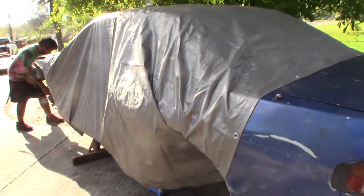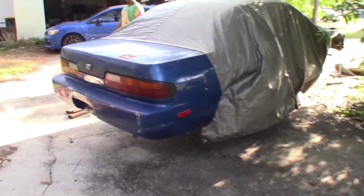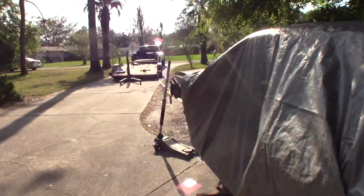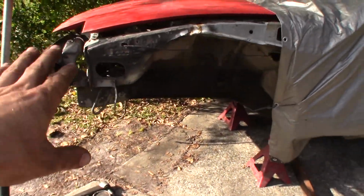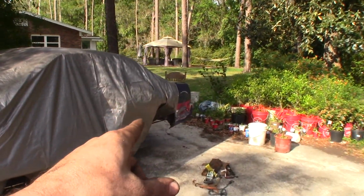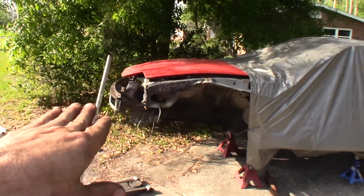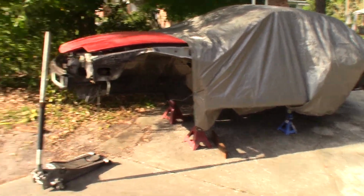Anyways, as you guys saw, we got the car unloaded. It's on jack stands. Really wasn't as bad as I thought it was going to be trying to get it off the trailer. She came right off with a little bit of convincing. Winston had the floor jack up front with the large 2x4 across the front, and he just held it. Nate was in the back with the cherry picker. We jacked it up there as you guys saw, and I just pulled the trailer right on out. We got to a certain point where we put jack stands under it, and from there, pulled right out.